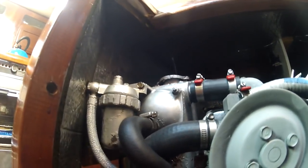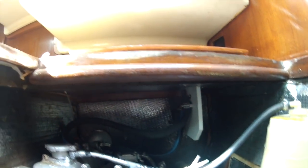Another thing to check when you're down here is to check the throttle, make sure that runs smooth, maybe lube it up a little bit. Also in the back is the shift change lever - I'll probably oil that up too. For this engine and the temperatures we have around here, I use 15W40.